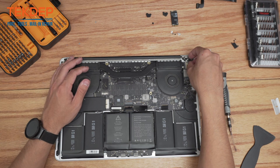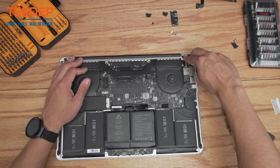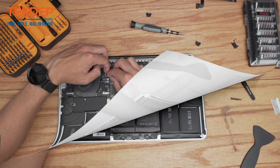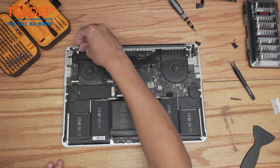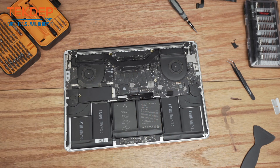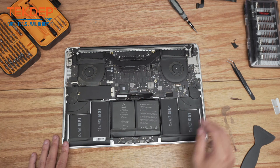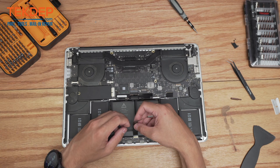Next I'm going to plug in the actual LCD connection on the right-hand side here — slot it in and close and clamp down the retention bracket. Now that we've got our Wi-Fi antenna cable secured, we're just going to place these little rubber grommets back where they go. They make sure the fans don't suck in the hot air that they just blew through the cooling system. The last step on the inside is going to be plugging back in the trackpad flex cable — starting down at the daughter board, close the retention bar, stick it back down to the top case and plug it back into its new home.